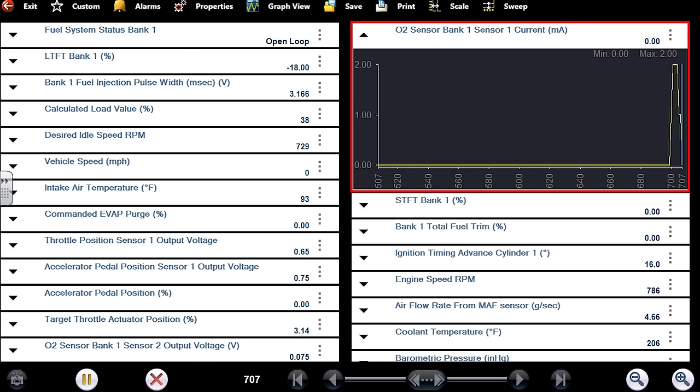We'll get some scope readings. Remember when dealing with wideband sensors, they all operate a little differently from each other. Using the downstream sensor was very helpful for interpreting what the upstream was doing. Comparing upstream and downstream sensors from the very beginning was an important piece. Making sure that the wideband upstream sensor was actually functional was really key in attacking this rich condition.